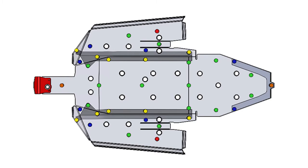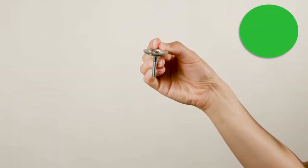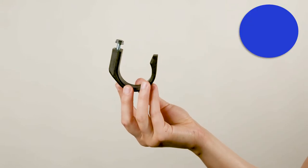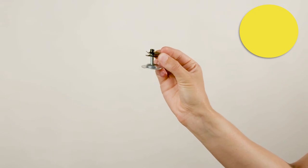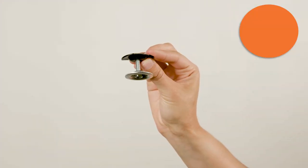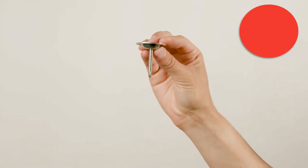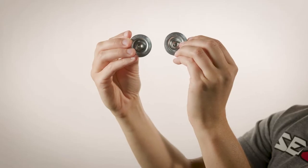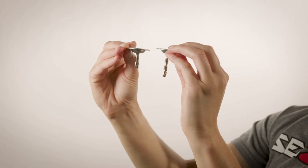This is what the Pro XP model looks like. Greens indicate that you put bolts in an OEM threaded hole, usually with a washer. Blue indicates that you'll use a type of clamp as specified by your manual. Yellow indicates that you'll thread bolts into clip nuts. Orange means that you'll use a bolt through an insert washer or nut. Red uses self-tapping screws, which may require pre-drilling of an eighth-inch pilot hole. Keep in mind that there are different sized bolts within the color categories, so you have to look at your manual for specific bolt placement.